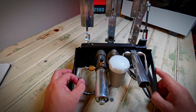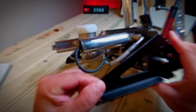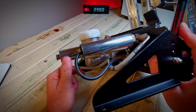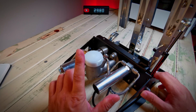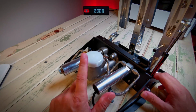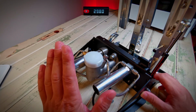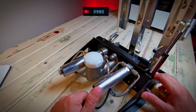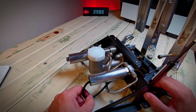So what we've got going on here, let's have a look. Master cylinder size, for anyone who wants to know, is 0.875 of an inch. It's another part of tuning. I've never used hydraulic sim brakes before, but on the cars we can tune the brakes with different size master cylinders to get a bit more feeling, either a tighter pedal or a much longer, softer pedal. So it'll be interesting to see if that theory works on hydraulic pedals.